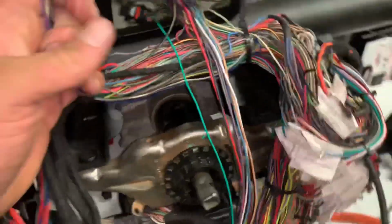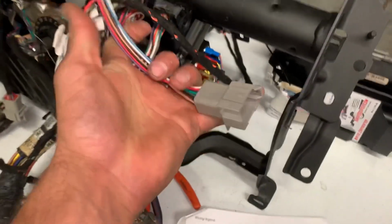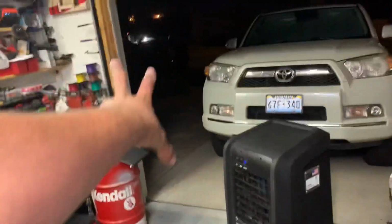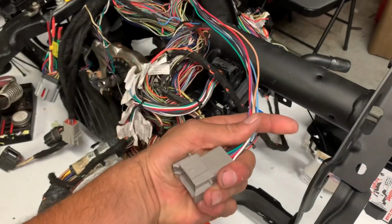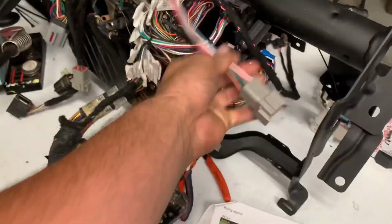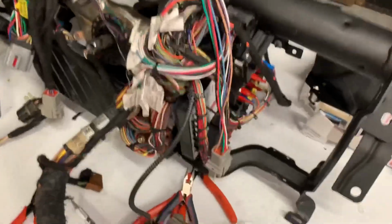And then what else I got to show you? I had something, but I put mine on a pigtail, the ones that go to the truck. So now that we already wired them in the truck, we have a plug on the truck, so basically I can take the dash, plug it in, plug in the cluster helper to the sensors, and she's ready to party. So I don't have one long pigtail running throughout the whole truck, basically kind of hard mounting the cluster helper to the truck. So now they're two separate harnesses for plug and play. So the more you know.